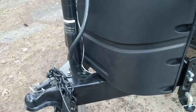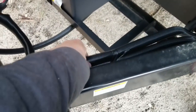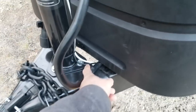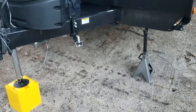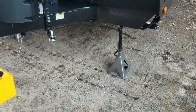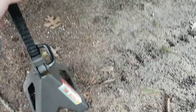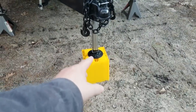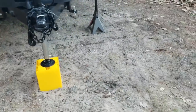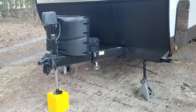A couple of things I noticed: the propane cover here is loose and flops around, and underneath it sits the power cord for my electric jack. I ordered some corrugated guard material that I'm going to put around the cord so the cover isn't resting on it and potentially damaging it. I also have jack stands barely resting under there. When you're parked at home on dirt, having them just lightly supporting the trailer takes a bit of pressure off and makes things nicer.